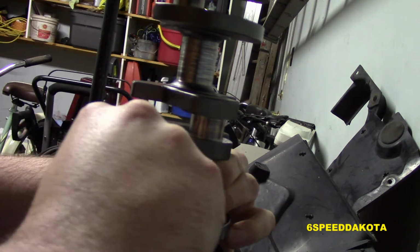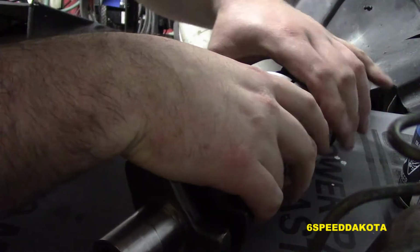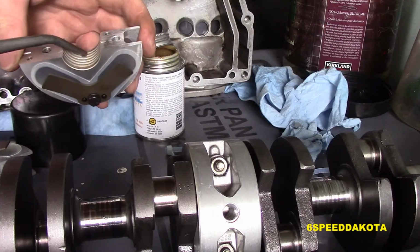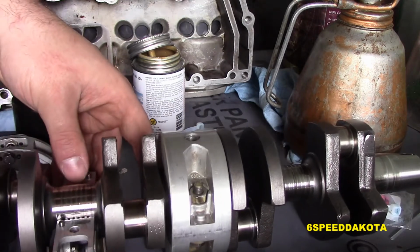And then on top of that, we'll go an aluminum clamshell to hold the entire thing in place. So really, you don't have to worry about the clip popping out. I did give these needle bearings a shot of 2-stroke oil before I put the bearing shell halves on. Now we'll tighten them down, torque them down. Just a little bit of 2-stroke oil to sit in the reed cage. This doesn't have any needles in it.